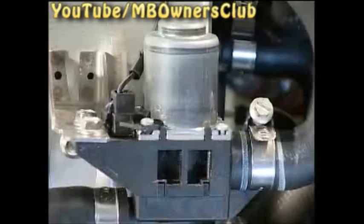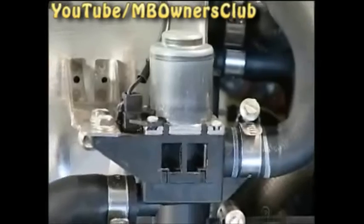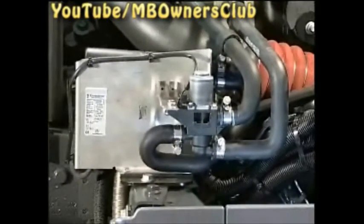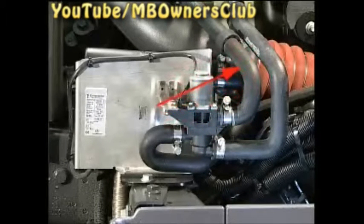Back to the installed heating appliance. Here you see the electric magnet valve with the water connections. With this valve, hot water can be pumped either into the heating circuit or the engine circuit to warm or cool the engine.